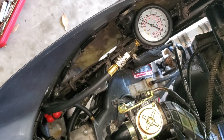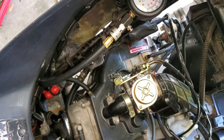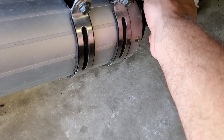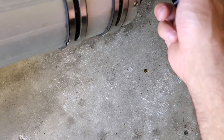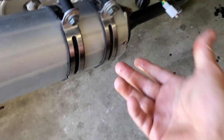I'm gonna go ahead and say this probably does not have a very good engine in it. I was concerned about that when they said they changed the oil. Unfortunately, if you just change the oil, why would it still be that color? Somebody rode this thing for a very long time with the same oil in it, and I'm pretty sure they burned up the rings. That is new oil I can tell, but it's off-colored horribly.